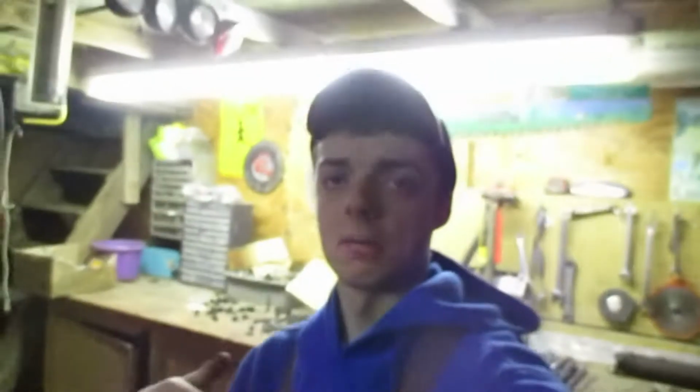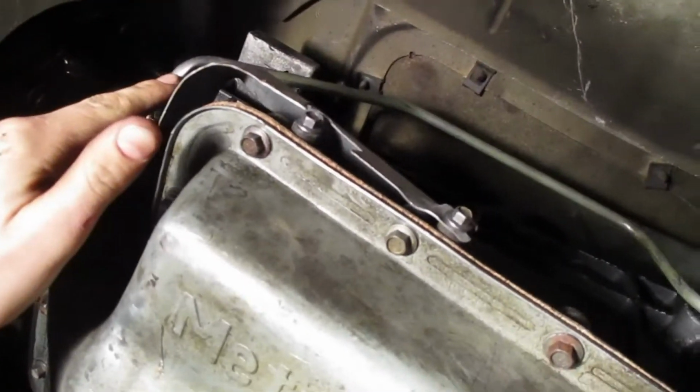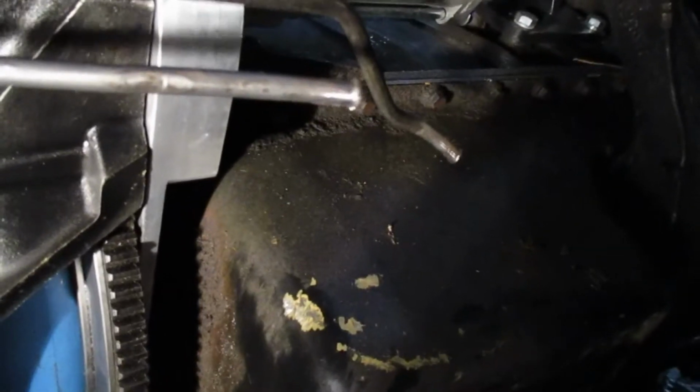Shortened and wiped down a little bit to kind of get that shine back into them. So now I'm going to go install them under the truck. Alright, I got this line on and this line on, and they both end right where I kind of want them to. Because up in there, it's going to get flexible, so I want them to go up in a steep upgrade. And the original lines weren't going to be able to do that. But I did flange these, so they will have a harder time slipping off if they decide to. But I'll check them regularly after we get this truck going, and make sure they're nice and snug.